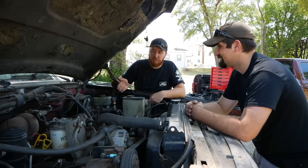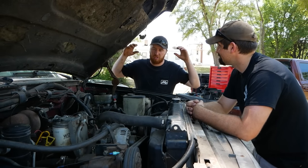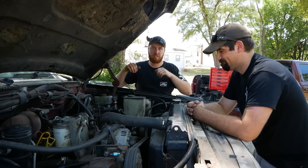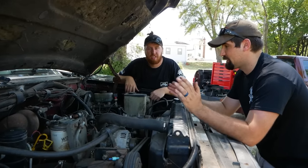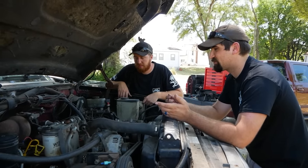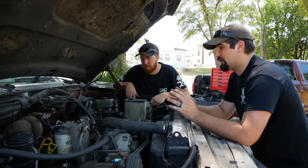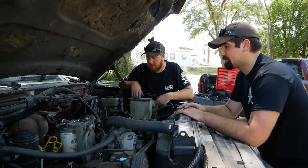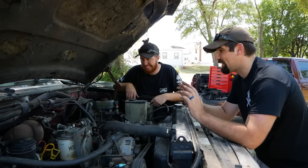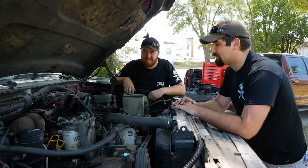All the ether we put in there dries motors out pretty bad. There's probably about no oil left in those rings, and all your compression's going zing and out. So, yeah. Oops. I'm going to start in by taking all the glow plugs out, checking them over, probably bench testing them. I brought some spares up that I had just in case they are bad. We're going to dump some oil down the cylinders, hopefully save what little compression there could be left in this bad girl, and have her going.